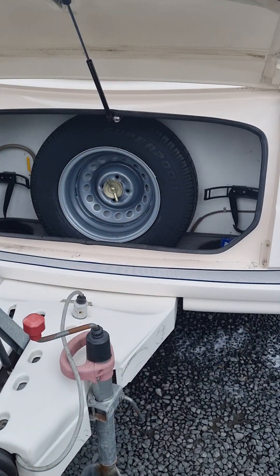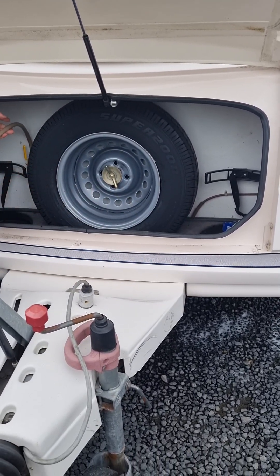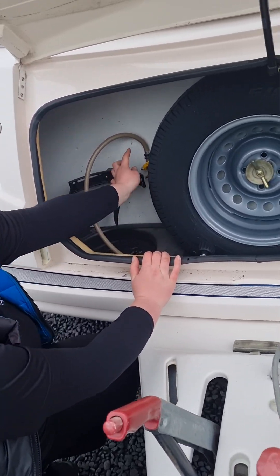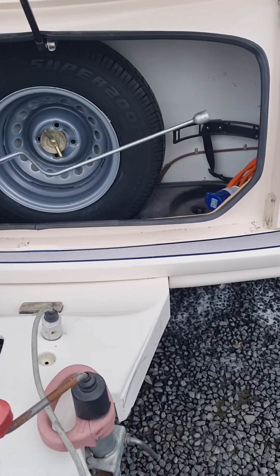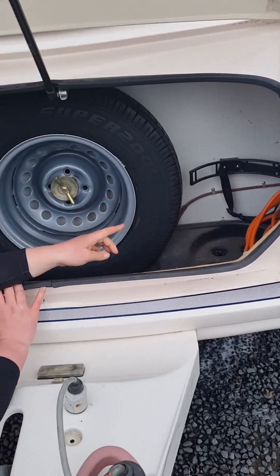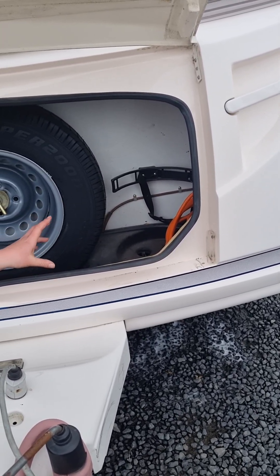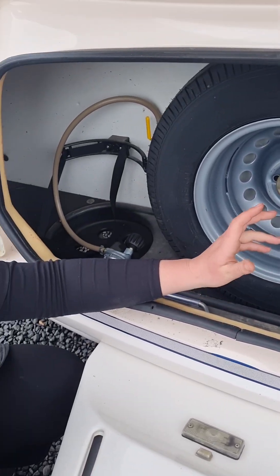In behind your A-frame here is your front locker. You've got the spare wheel and space for two 9-kilo gas bottles. There is only one connection on the left, so you will have to manually swap them over — it's got a standard barbecue spin-on connection. If you ever want to shut the gas off entirely, push this yellow lever around and that will shut your gas off. You've also got your leg winder in here to raise and lower the stabiliser legs, and your mains power cord. This front locker has holes and grills in it so it is open to the elements — don't store anything you don't want getting dusty or damp. These front lockers have a payload of about 20 to 23 kilos, so once you've got two gas bottles and your spare wheel in here, don't overload it as it will affect the towing of the van.